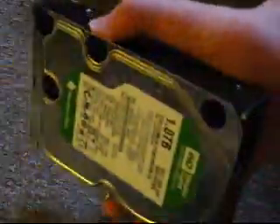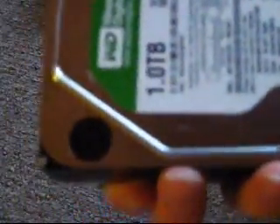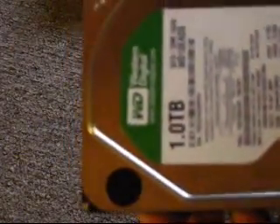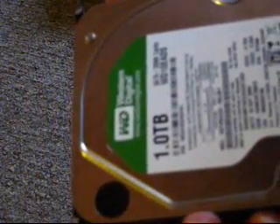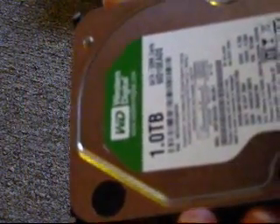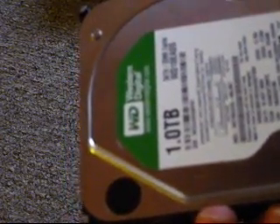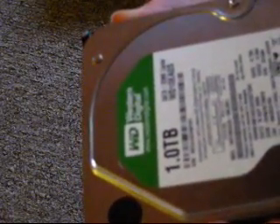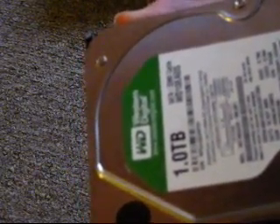You've got yourself a totally naked hard drive. These models of external hard drives have the Western Digital WD Caviar Green — this is a one-terabyte, but depending on what size you bought. So this is a very eco-friendly one. It is a little bit slow — only 5400 RPM. This particular one was made on the 18th of September 2009, 5 volt DC — it's just got a lot of information on there.